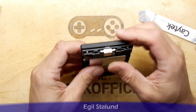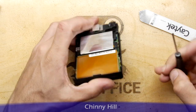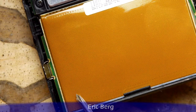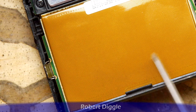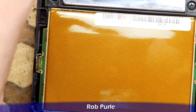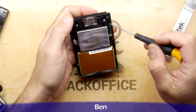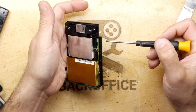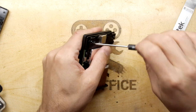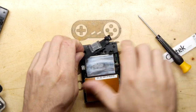Now you can clearly see that magnetic stripe reading assembly — same as a tape head. We'll pull that apart. Fascinatingly, look at this thing at the bottom which looks like the card reader, but if you look closely it's covered with a very fine ribbon cable with loads of lines everywhere. I suspect it's either some sort of shielding or a protection system — if you damage this enclosure it'll detect that you've tampered with it, probably to stop you inserting your own card reader. I'm not seeing any obvious physical buttons that would have been triggered, and there could be a light-sensitive component, but I'm not seeing it just yet.